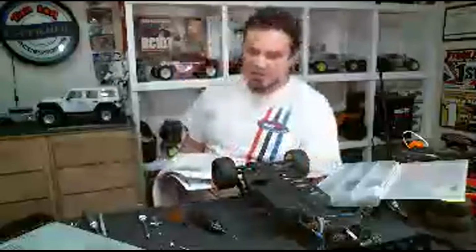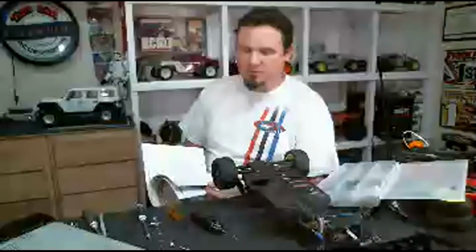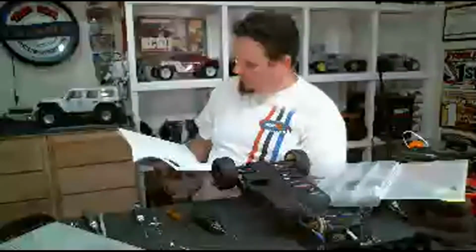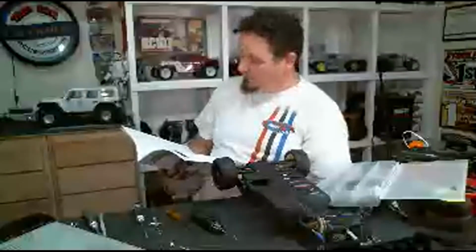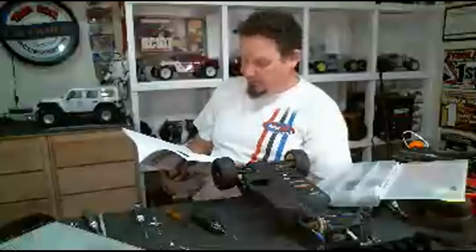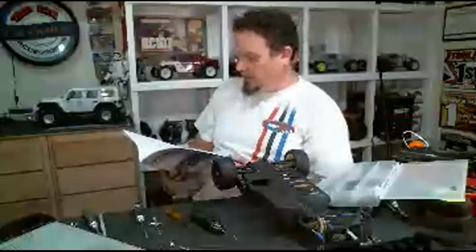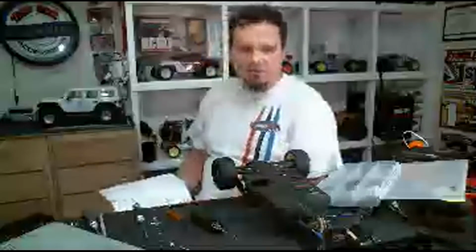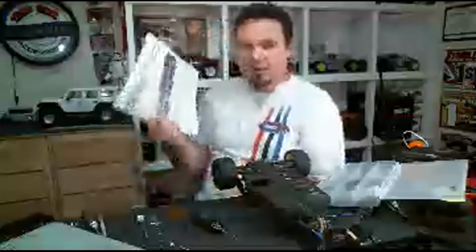You know what I miss about instruction manuals, by the way? Since I have this out, might have said this before, but tips and hints from the team. And then they would go through all of these different things. And you could always, if you got lost, you could refer to this. If you're trackside, camber link. Making the camber link shorter tends to give more off-power steering into the turn, but can also make the steering feel a bit erratic. Making the camber link longer will slow down the reaction of the steering. That's what we need nowadays with all these different adjustments we can make on our cars, and yet hardly any instruction manual.